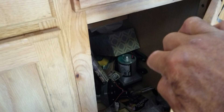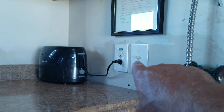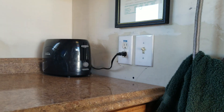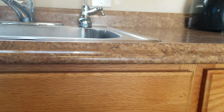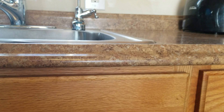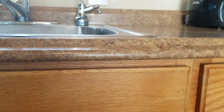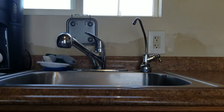In the bottom of this cabinet I've got my water pump — a 12-volt pressure-activated pump. That's the switch for it right there. If I'm going away, I don't want to leave it on, because if a line burst, the pump would just keep running until it drained the whole water tank, and then the pump would burn out. So I put a safety switch in there so I can shut it off when I'm not here.